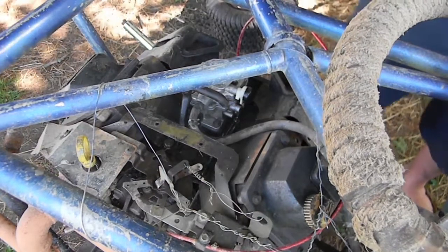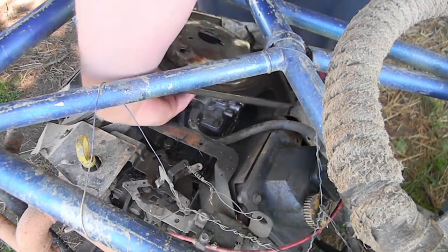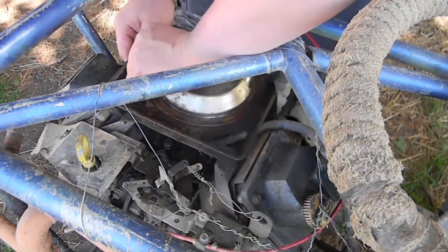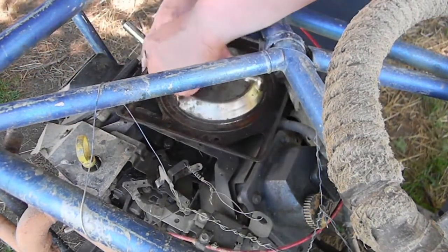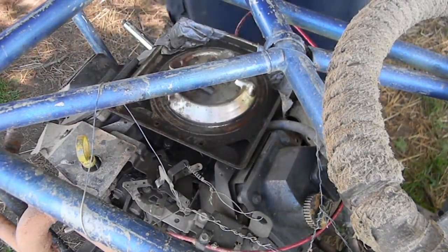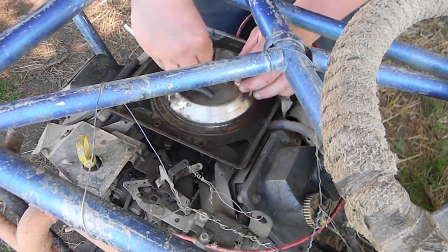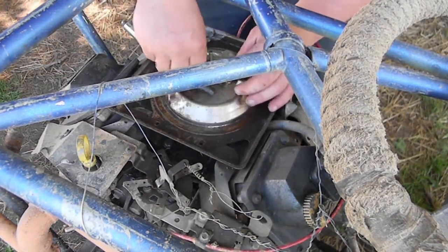So yeah, if you're doing this, I'm sure there's probably some fancy torque rating for it, but I just snug it. That's all. It doesn't have to be crazy tight, doesn't need a perfect seal. It's just got to be good enough. It's got a gasket. It just has to not back out and fall off. You don't need to strip the block out. It's aluminum. Little's all you need. In fact, the only things I will use the torque wrench on, now that I have one, are head gasket and connecting rod. Other than that, I don't give a damn about torque specifications. Common sense doesn't fail.